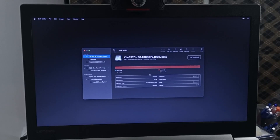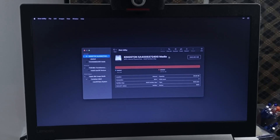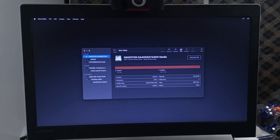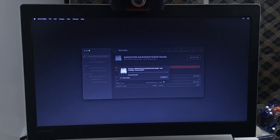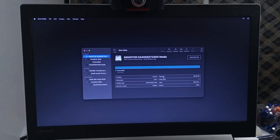I have a 240GB drive. At the top, click Erase. Name the partition, set the format to APFS, and the scheme to GUID Partition Map. Click Erase to confirm, wait for it to complete, then click Done and close Disk Utility.